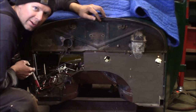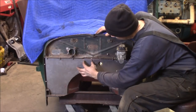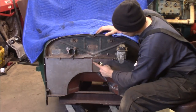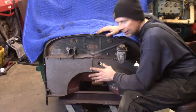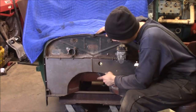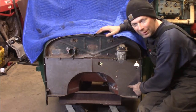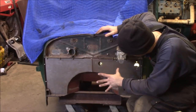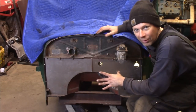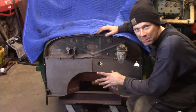I'm going to go ahead and work on the other side now and get the other piece roughed in. I've got a big overlap here — I'm going to cut it at this red line and butt weld these two together. I'm going to do some trimming and cut my steering column hole down here. It's looking good for roughing in, so I'll take both pieces out, trim them up, punch the wiring hole on this side, and do a couple other tweaks.